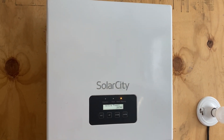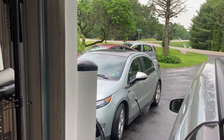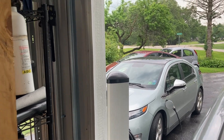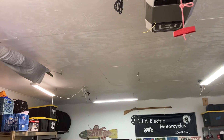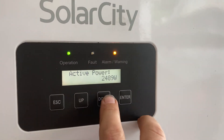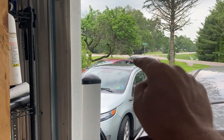The other thing I'm doing right now is I am charging our Chevy Volt plug-in hybrid electric car out there, and that typically charges at about 3,300 watts or so. Plus in the garage here I've got about 400 to 500 watts of lights and other things taking up energy. But if we look right here, the active power being produced by the inverter is only about 2,500 watts — that's less than what we know that car over there takes to charge.